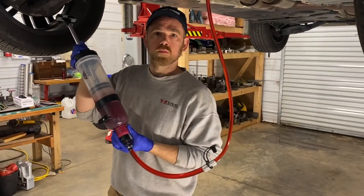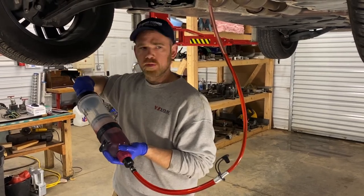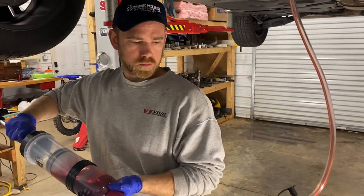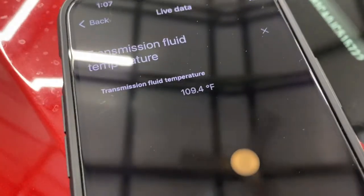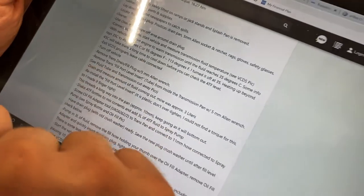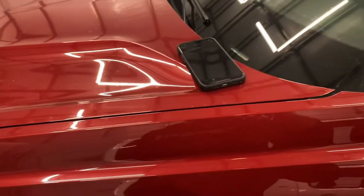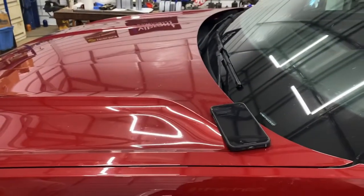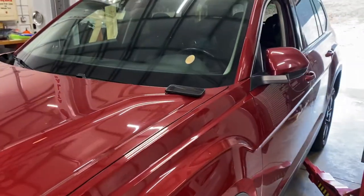What was the temperature spec we're looking for? I'd have to double check - I want to say 25 to 35°C, but I'll verify. It said 109.4°F - from 95 to 113°F, which is 35 degrees Celsius. We're good then. Just gotta double check the torque on the drain plug down there and put the belly pan on - she's right as rain.